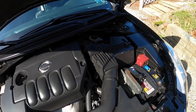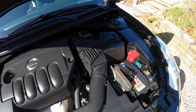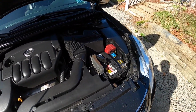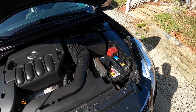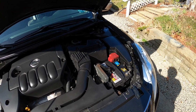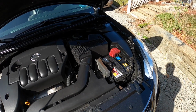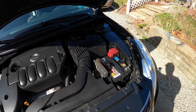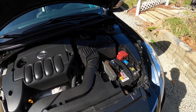I mean, it completely collapsed and the engine was basically just sitting metal on metal, and that created a lot of vibration. So like I said, not really sure why those are such a high failure item. Maybe somebody can comment in the comments there. Figure the original Nissan one lasted probably 80,000 miles, so it would probably be better to go with the OEM next time around. But we'll try the Dorman last, see how long that one lasts. No pun intended, from AutoZone, not a sponsor.